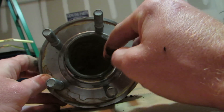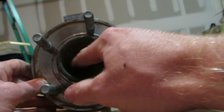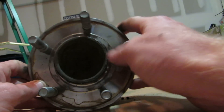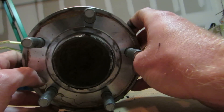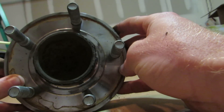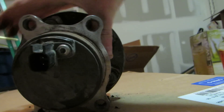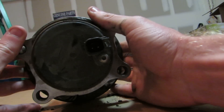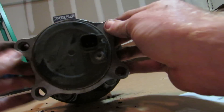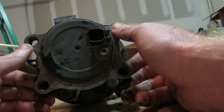From around 2000 to 2011, there used to be a center bolt here with a center nut, and that's where the bearing bolted up to. That's no longer there anymore — it's just cast iron in there, hollowed out. What you have now is a sensor right there and four bolts, and these bolts are a ten millimeter six-point bolt.